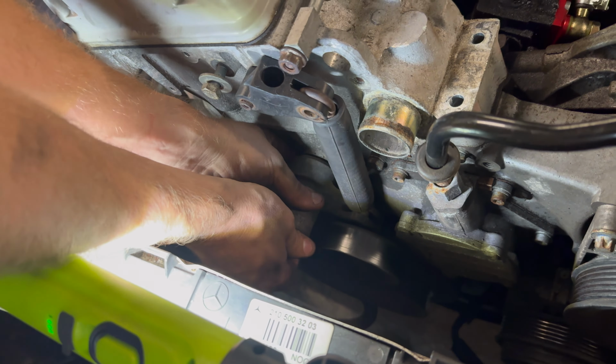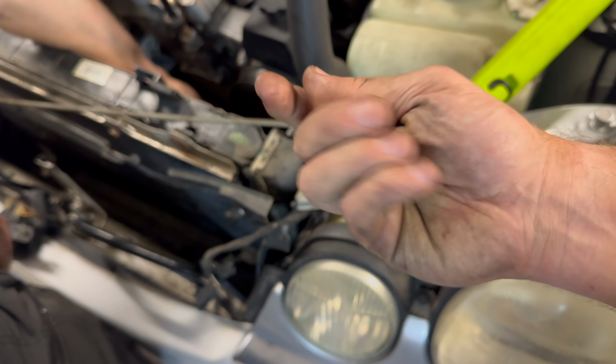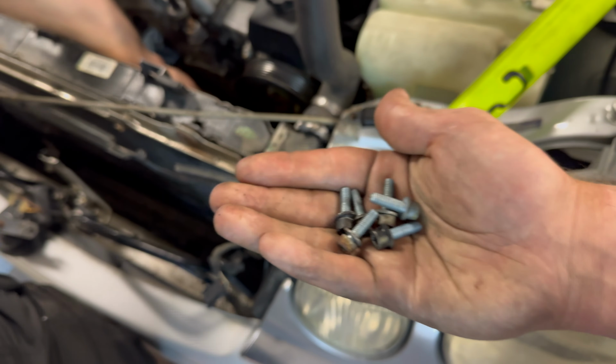And then, like I said, don't reuse that gasket. That's why you have a new one. All right, Connor's working on the last bolt, but there will be 7 bolts in total for the vacuum pump. All right, so the line that goes to the vacuum pump, we use a 3/4, got that off, and then I stand corrected. There is 1, 2, 3. There's only 6 bolts, and then here's the vacuum pump gasket itself, and then this is where we're at.